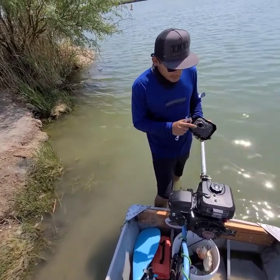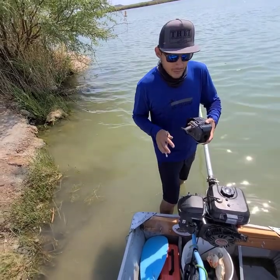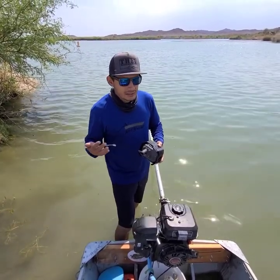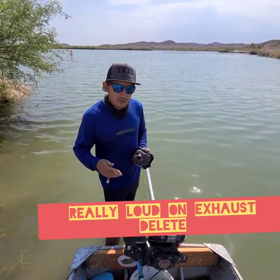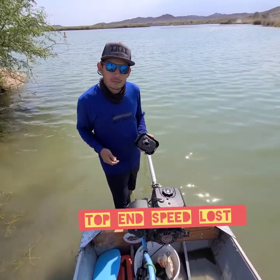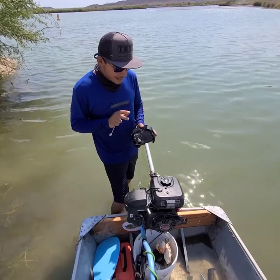These are 10mm bolts, and removing these actually acts almost as if it was straight pipe. I did try the motor with these removed and I did lose top end horsepower, which I believe is because you need some back pressure on these motors — especially motors that have high weight or resistance to them, as opposed to a mini bike that might be easier to rev up and get up to speed. These are at times running at 1000 RPM and need that low end torque. So I believe I'm going to keep the factory muffler.